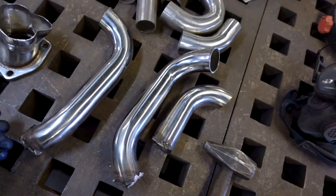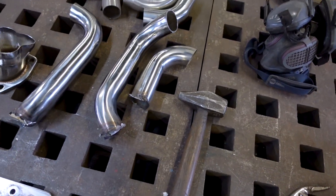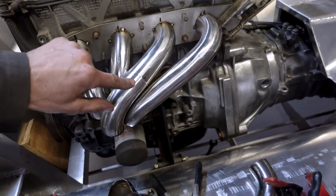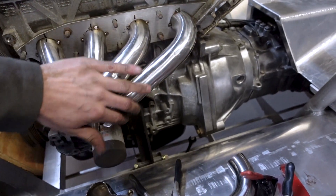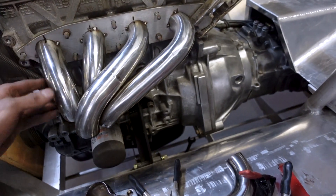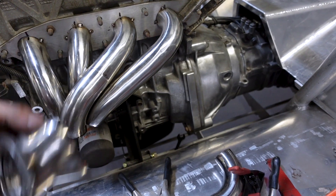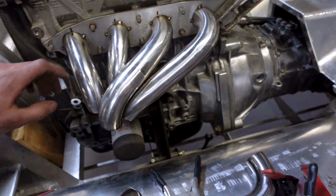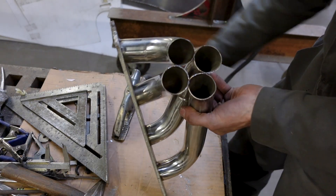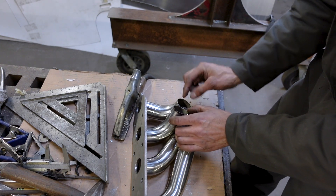This is what I have for tubing to work with after cutting up those headers, and I got a couple more pieces left over from other projects, so I've got to put it all together. Okay, I just finished putting the last piece in — did this one, this one, this one, and this one. All these I didn't have to change the bend radius at all — just positioned them and trimmed the corners. This one I did modify and you can sort of see where it seamed together. This goes right on here as your coupler. I've got to take it off, trim it flat, and weld a little piece in the center. I got the header off — see that little hole there, gotta fill that in. I made this little triangle piece — just going to tack that in and fuse it around.